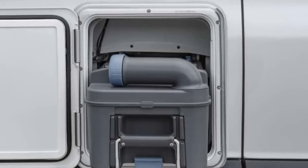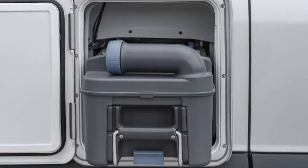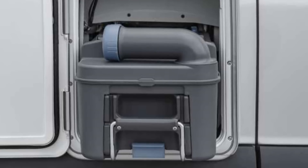If you're concerned, you can just dump some RV antifreeze down your sink and it goes right into your gray water tank, lowering the temperature at which it can freeze. There is no black water tank on the Rebel because they use a cassette toilet. That cassette, when you slide it in, is stored on the inside of the coach in a heated compartment that's heated along with the rest of the interior — so that black water tank is in no danger of freezing whatsoever. It's a great design for four-season winter camping.